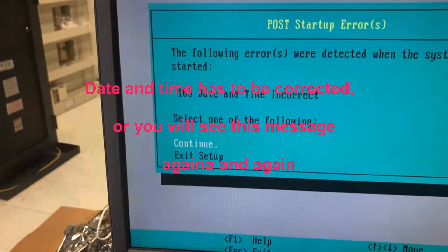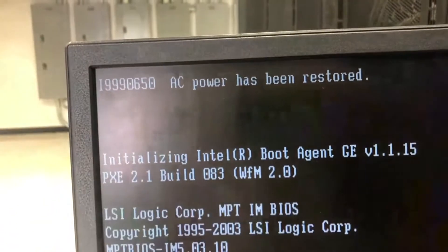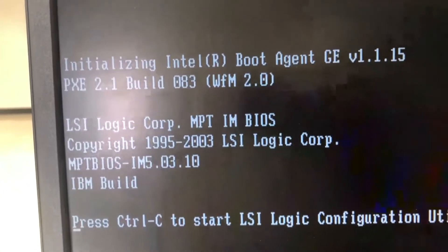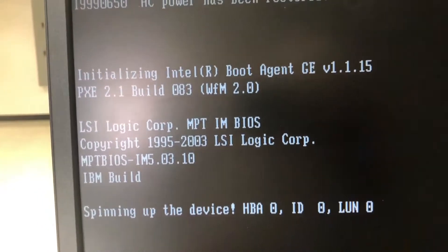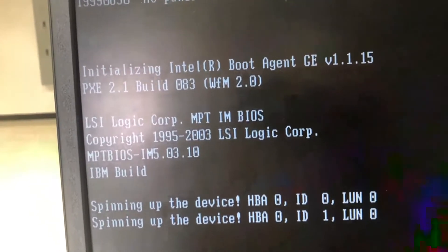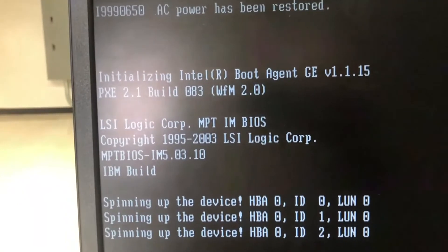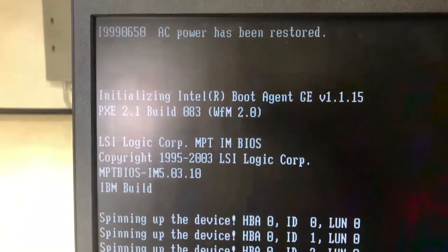Remember you saw a few minutes ago and it said it's fine, correct? So basically you replace the motherboard, CPUs, as well as memory. Before it did not boot — there was an issue with the whole thing. If it did not come up at all, it's the CPU. If it's not the CPU, you do the memories. If it's not the memory, you do the motherboard and so on. I did all that. Sometimes it may give you a timing header — make sure you correct the timing, the date. Because you will have an issue as well.